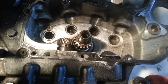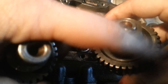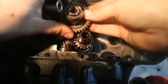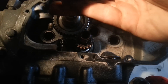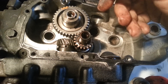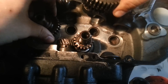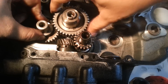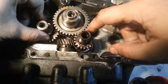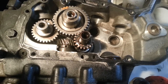These are our first two cams right here. This one has three timing marks — one, two, three — and the one in the middle lines up with your 11 o'clock mark. It takes a lot of putting these in and taking them out, so put one in, find your timing marks on the other. Slide this one in — it's a little bit off, easy fix — pull it out, turn it to the right a little bit, match it up. Now it matches here but it's not lined up here; pull it out, rotate this cam — boom, matches up.